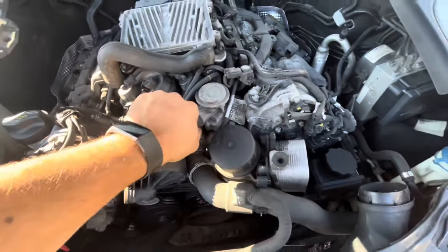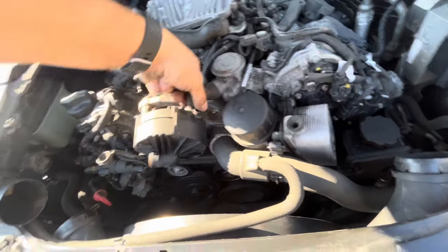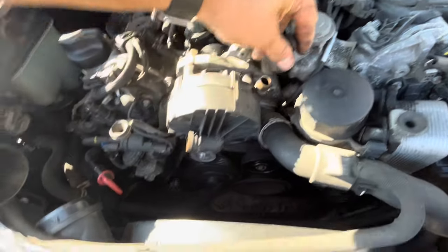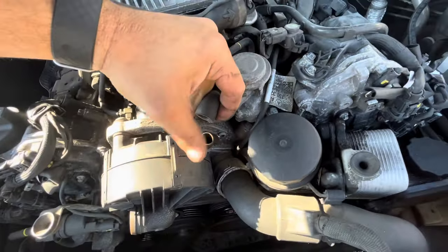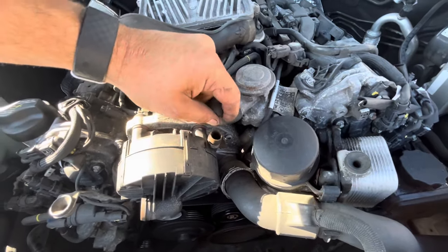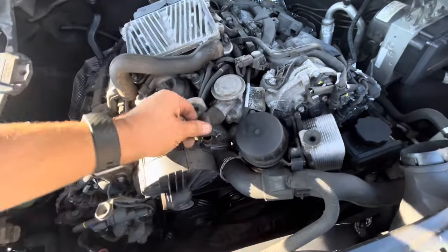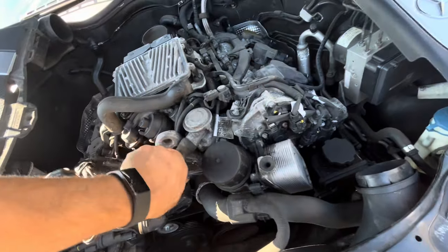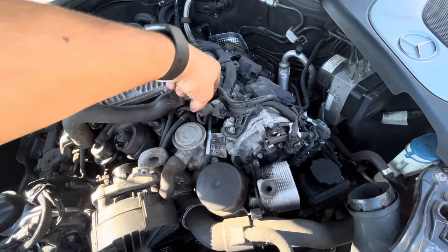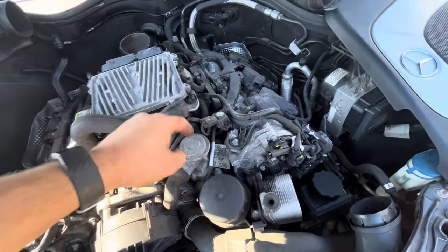It's pretty easy to do on these. You can pull the hose right off at the pump — you can actually see smoke coming out. You can plug off the gate valve and see if you can isolate the exhaust right here. I can see this one is stuck open. Then check the other one the same way. If you want to make 100% sure you don't have a problem with the vacuum control valve that feeds vacuum here, you can pull this right off or pinch this off, just to verify there's no vacuum being fed to it commanding it open.